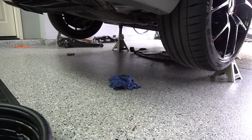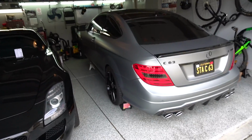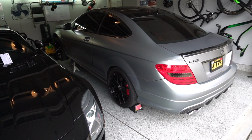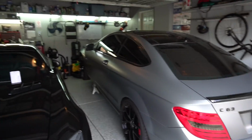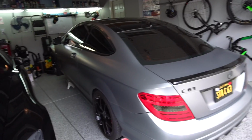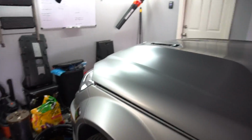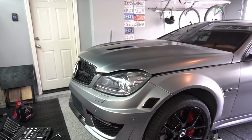Alrighty guys, it basically sums up this video on how to do an oil change on the 156 motor. This could vary between models, for example C, E, and S, and ML and SL and all that, but the basic procedures are the same. The only part that may differ is taking off the underbellies, in terms of bolt size and just what you need to take off. But this is pretty standard for the C63. But you guys should be using 5W40 no matter which car you're using. I believe all the oil pans have the same capacity of 9 liters. And it is pretty normal for these cars to burn oil, so you just gotta refill them every once in a while, just check the dipstick.